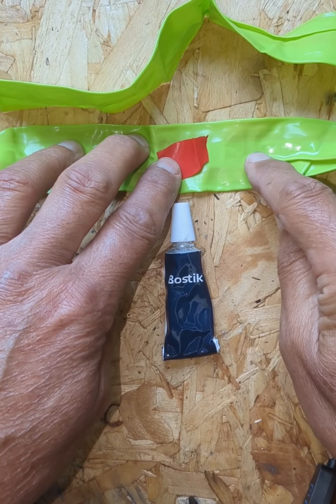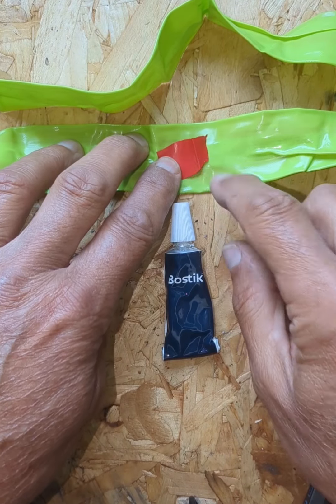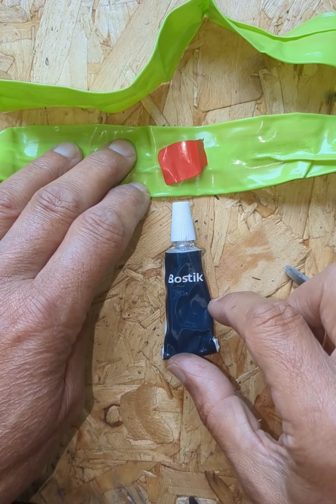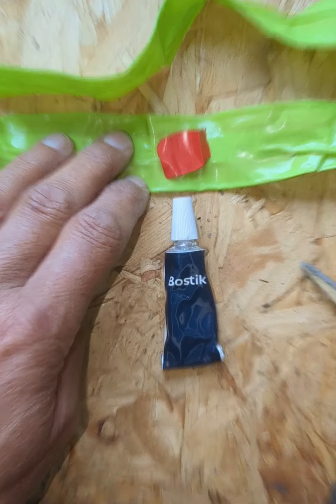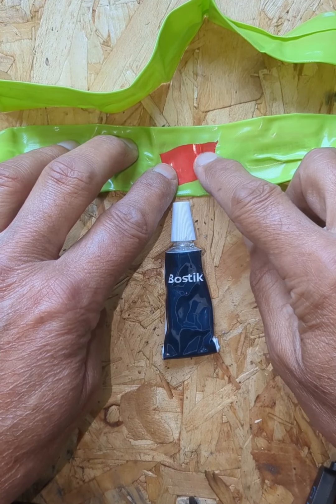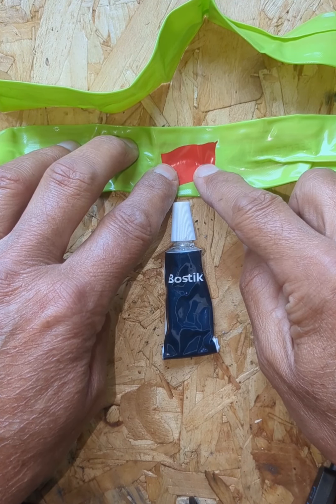So you need to be careful when using this glue and putting a patch on. Don't put too much pressure in the tube — just enough to give it some shape. After a while, once the solvent has evaporated, the tube is then fine. This patching method I've found is effectively a permanent patch; I haven't had one come off yet.